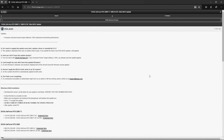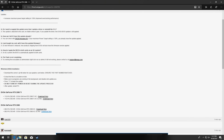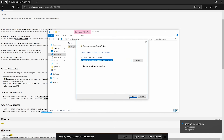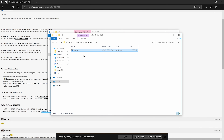If we go here to our forums, we have a post from Jacob that has the instructions and also what the actual BIOS update does. This particular card that we have is a 2080 XC Ultra, and we select the download for that file. We'll save that file, open it up in Windows Explorer, extract it, and then there's a simple update file. Right-click and run as administrator.